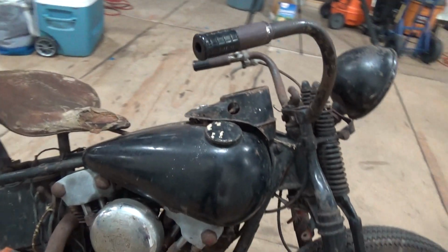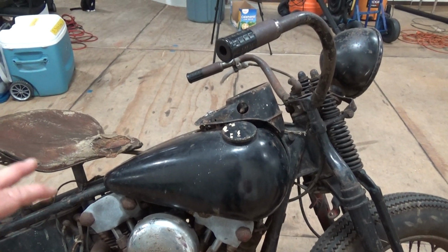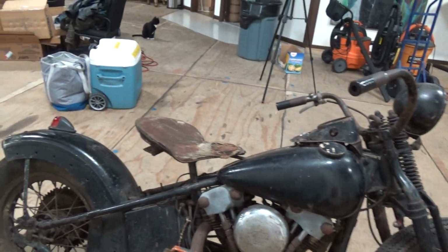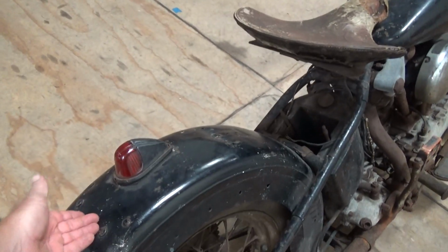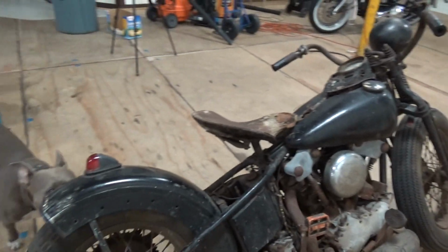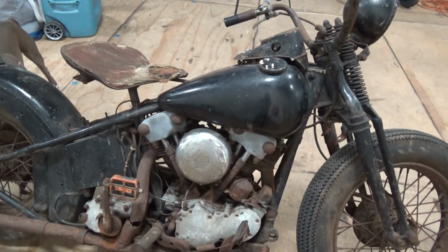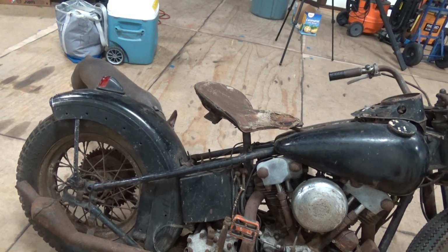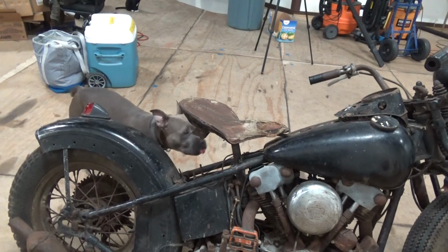That's all '37, except it's got '38, '39 heads with a four-bolt main, an M5 carb, and that's a pan head air cleaner. While it's a narrow strap rear fender, it doesn't have the butterflies underneath, so it's a later production than this machine. It tells me the fenders were toast. It's got round floorboards. It tells me the square floorboards were toast. You follow me? It's missing the original muffler, but the way it's done and welded tells me the muffler was toast. They just made something work.